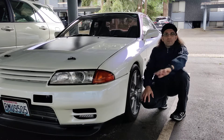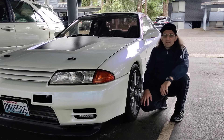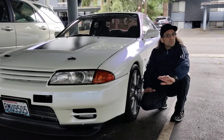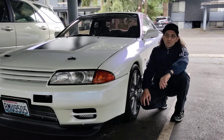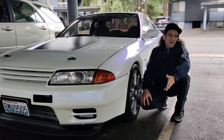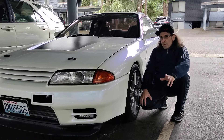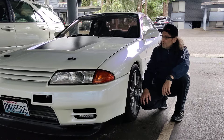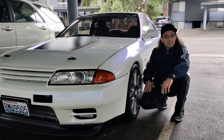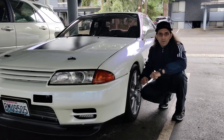The car is running 15 PSI of boost — I set it up at 15. The turbocharger can't make it on its own because the wastegate maximum is set to 7 PSI fully open. So you use one of those manual boost controllers, but for the rest it's doing its job properly.